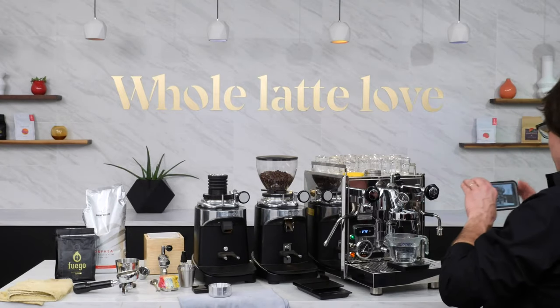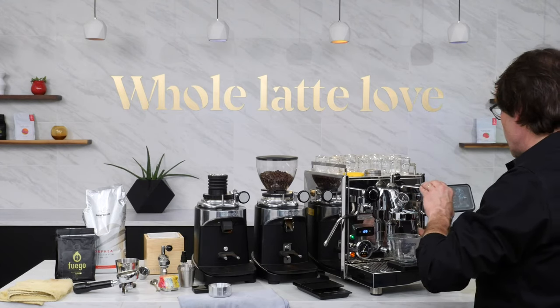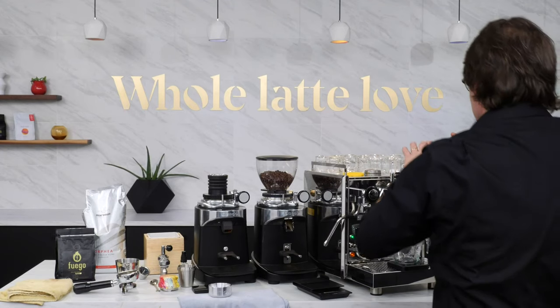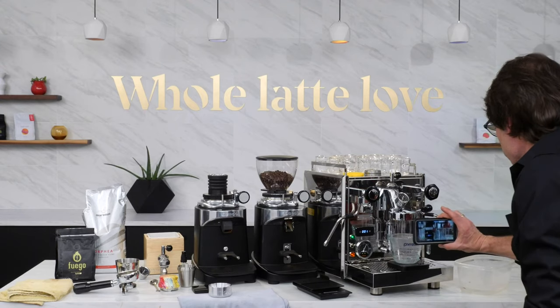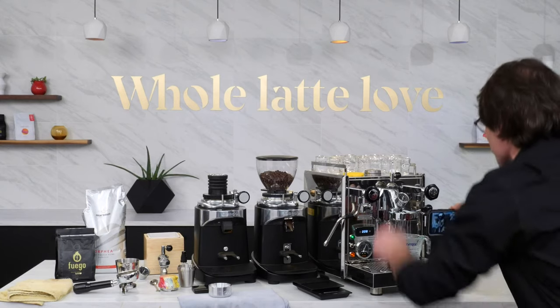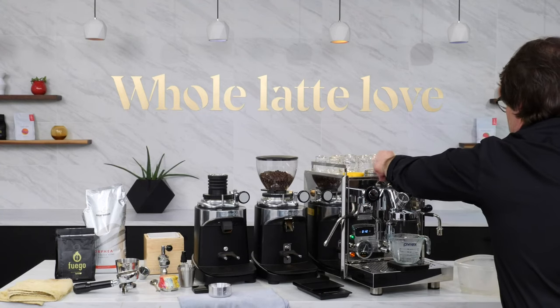But I want you to see what happens when you run this machine wide open, which you really don't want to do. So I'm going to open this up. I'm going to go 2 turns on this. 1, 2. And watch how fast that water comes out of here. I mean, it is just jamming out of there. That's that near 30 grams per second. It's still really nice flow out of that shower screen. But as we bring it back, I'm going to bring it back here now down to nothing.